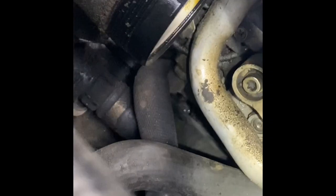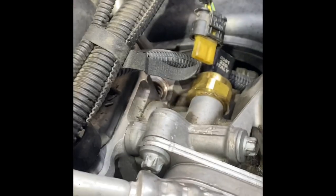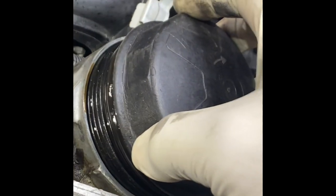Right down there is where it goes. There's a connection right there — I've already moved the little clip. To get these hoses off, basically you just take a screwdriver, put it in there, clip this clip at the little opener, and pull that clip out. I've already removed the oil filter cap with the wrench — I just wanted to loosen it so that oil drains down in the housing back to the engine. That way when we remove the oil filter housing we don't have oil gush out everywhere.